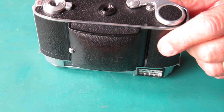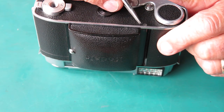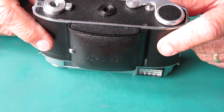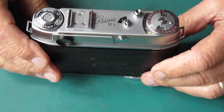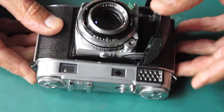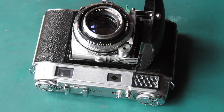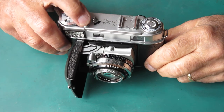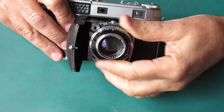You can fix that up with a little bit of black wax if you like, or cut a patch - I'd normally cut a little triangular piece and insert a matching piece of leatherette, and it'll be as good as gold. That was the first problem - easy! If only all camera repairs were that easy. We can move on to dealing with the shutter release timing problem.